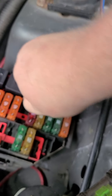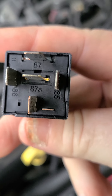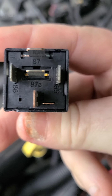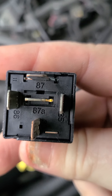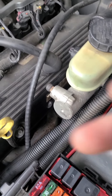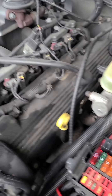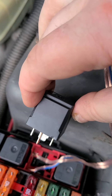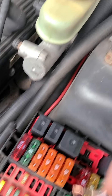Take the cover off, find which one is your starter relay — on mine, this Mustang, it's this one. Take that thing out of there; it's easier to use pliers, they don't come out too easily. You want to look on your relay and you're going to see an 87 and a 87a — the flat one. So you look at how it goes in: you got the flat and then this one is sideways.